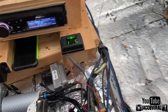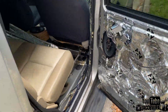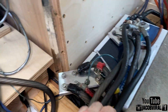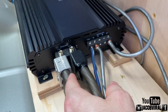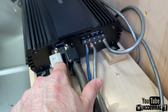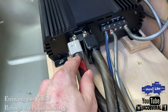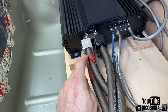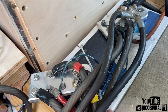So what I'm going to show you is where you want to put it. There are two options. I personally would recommend running straight to your amplifier input. If you have more than one amp, then just choose one of them. This is the most efficient place to put your voltmeter reading — on the power wire input for your amplifier. I personally prefer the battery because that's where the supply is. Number one option would be your amplifier, second option would be your back battery.